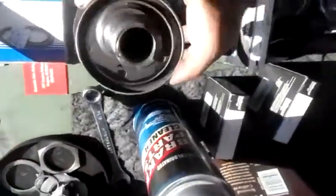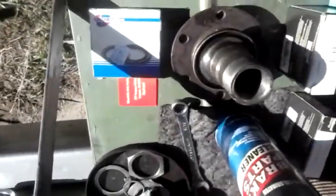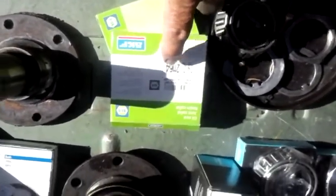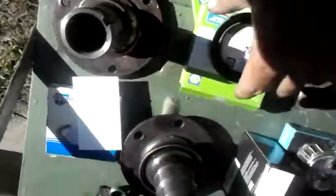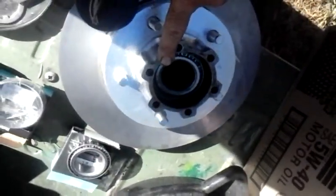You can see here that we have a 44-287 seal — that's this one. He fits nicely on the disc brake spindle, but he doesn't fit the drum brake spindle because that spindle needs a different seal. So I went and crossed it. The guy at the parts store looked at the inner and outer diameter and came up with a 211-64 Napa seal, which is also a Z-015 National seal. This seal allows you to use the original spindle and adapt to the hub you need for the disc brake.